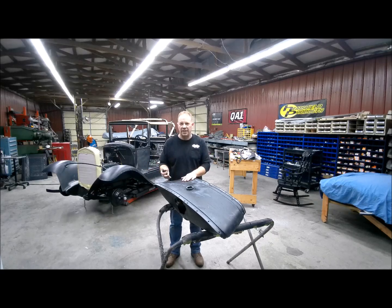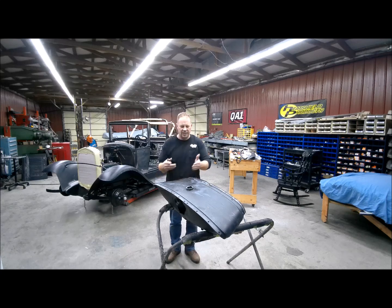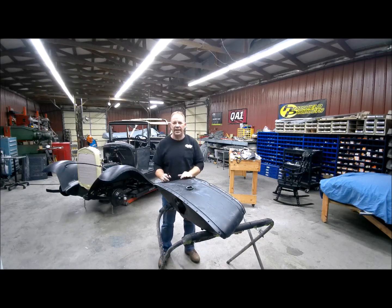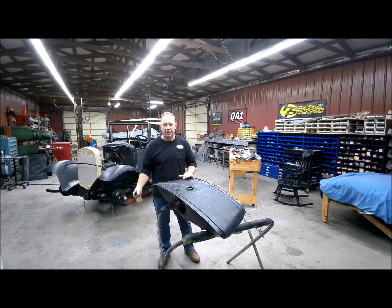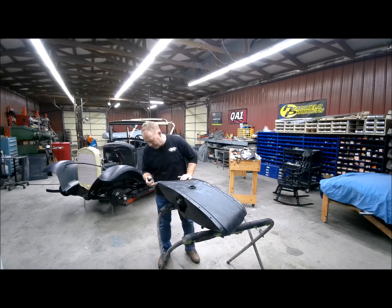Then to make sure it was clean, because I've got two baffles in here, two little splash pans that are right through here, and I can't see on each side of that, and it's hard for me to get in there and clean. So I ran some wash thinner through it, and when I got the wash thinner through it, some more of the lacquered fuel came out. So I've run almost 3 gallons of wash thinner through it, just washing it and cleaning it and rotating till it's about near come out clean.